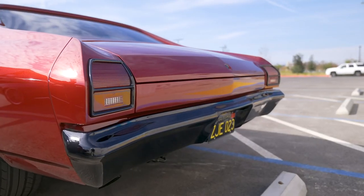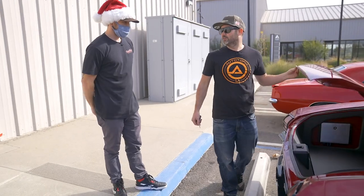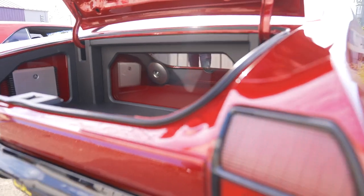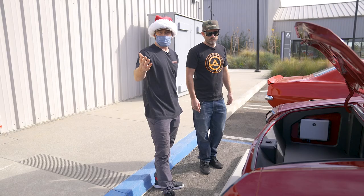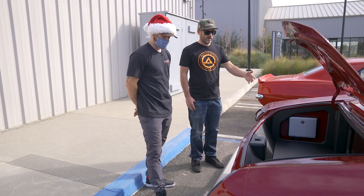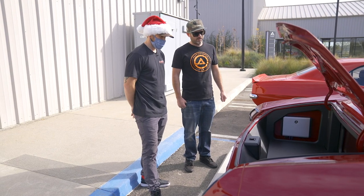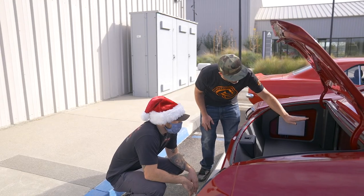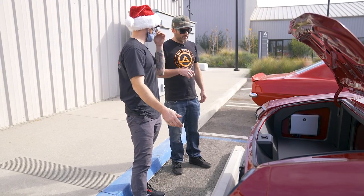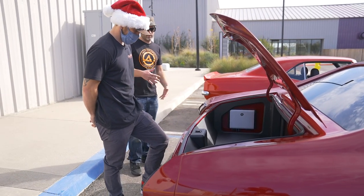Being from the Bay Area, they like their music — so you can't build a car top to bottom, front to back, and not do the trunk. The trunk features JL Audio W6 12-inch subs — W6s, not W7s — and JL digital amplifiers, which are top-of-the-line. The W7s would require a much larger box for air volume, so W6s were the right choice. His buddy spec'd out the box, which is built to go up around the Chevelle's trunk step to maximize forward placement and preserve some trunk space. The carbon fiber was actually first used in the trunk, and then carried into the interior.